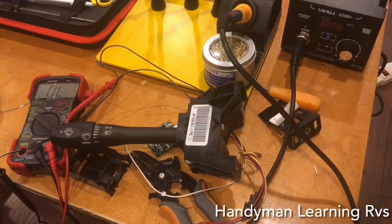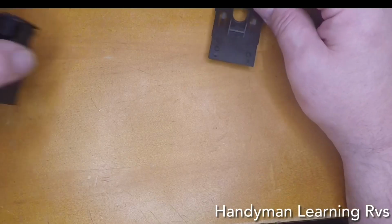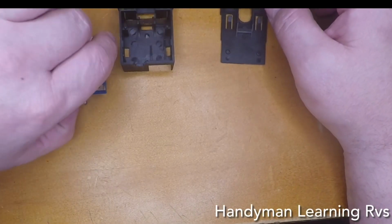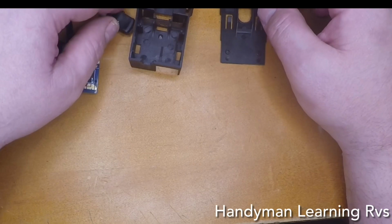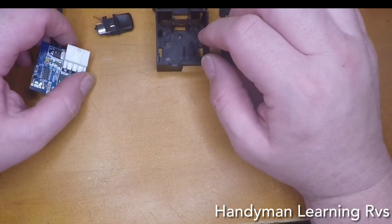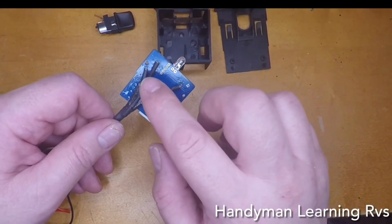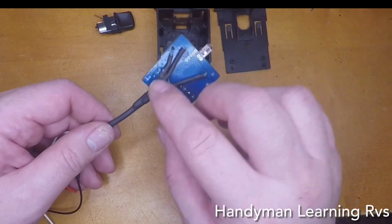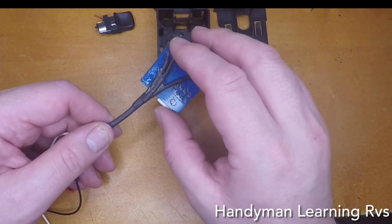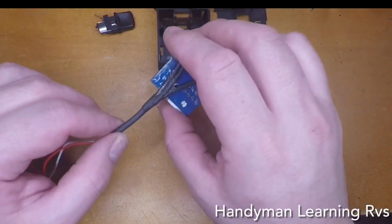Now all I have to do now is put the aftermarket switches together and test them. Then put some end connectors on. Okay, now let's put the wiper switch controller back together. Grab all the pieces. Already got the notch cut out in the back for the wires to pass through. This is finished. The wires have been heat shrinked, glued to the circuit board, and then I put another piece of heat shrink right here to hold it all together. It's not going anywhere.